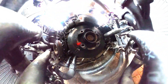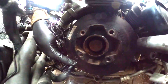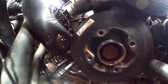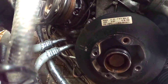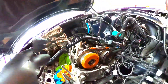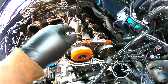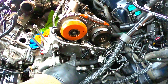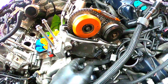Down here you can see where it says 'MP' and there's this little notch. There's a tool that goes over this - you crank it around and then lock it in position. That sets it 150 degrees before top dead center apparently. Then when you've done that you can check the timing up here to make sure the camshafts are locked. When you're happy with that, we also need to take this cover off and do the tensioner.